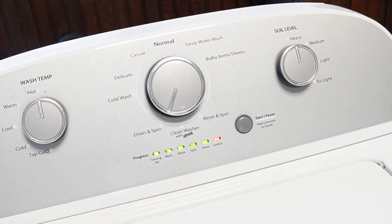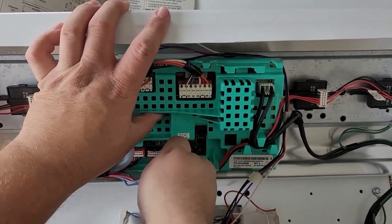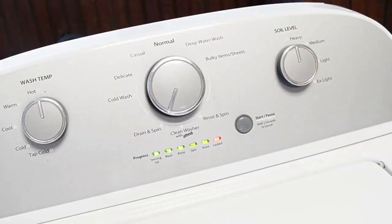This is a must-have when parts aren't working right or the machine doesn't know what state it's in, like after replacing a shift actuator or control board. During the approximate three minutes, you'll hear all kinds of noises from the machine — that's totally normal. When the calibration mode ends, every single light turns off including the lid lock light, and the machine is now ready and recalibrated for use at an optimal level.